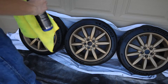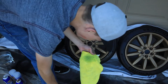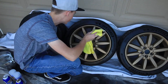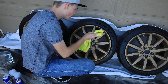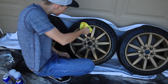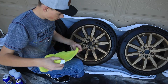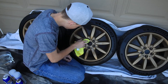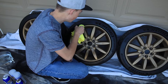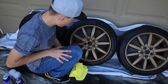Wow that looks so good - that's gonna look absolutely insane on the car. I'm gonna peel the other three and then ceramic coat these, because you need to protect your dip otherwise brake dust gets permanently embedded in it since it's stickier than a regular wheel. I've got my Adam's graphene ceramic spray coating - it's seriously so easy to apply. You basically spray it on and wipe it on. Technically you're supposed to use an applicator pad but I'm using a microfiber. It gives a nice gloss appearance that gets buffed off when you're done, taking it right back to that same satin finish.